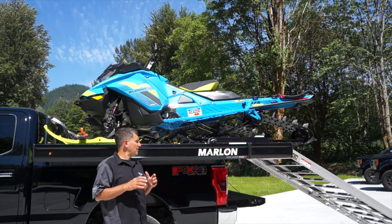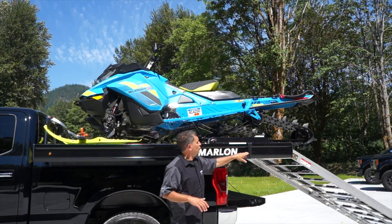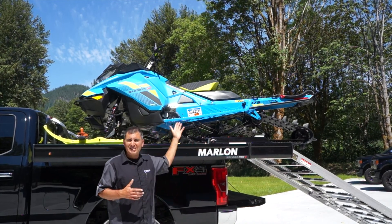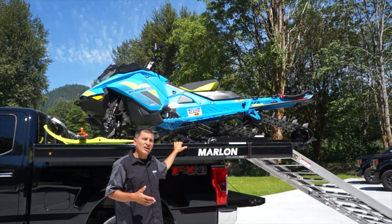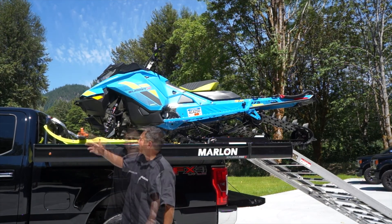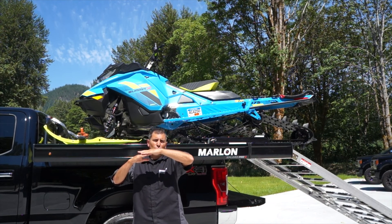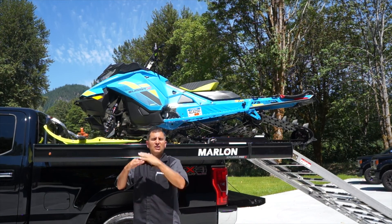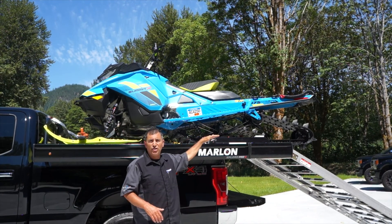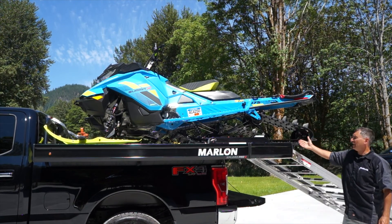This is the seven foot deck and it has a two foot extension on it. What we often see is people going down the highway with a 175 on a seven foot deck — you're actually not legal because you're four feet out of the back, and it's very unsafe because the super clamps were never designed to carry that load bouncing up. When you hit a bump on the highway it can pull up, so the safest way is to ensure the snowmobile is flat on your deck.